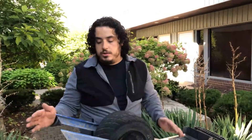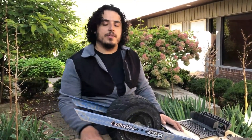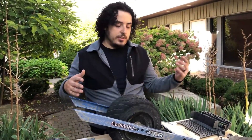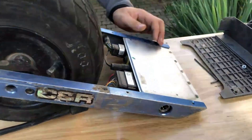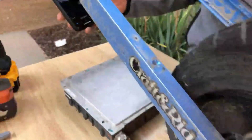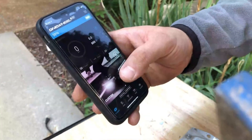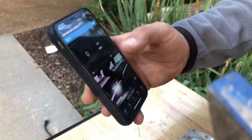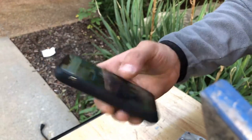Once you've secured the battery and it's all sealed up, a good step is to actually plug it in and make sure everything is working — that the harness isn't damaged and the battery is plugged in correctly — before reassembling, just in case you have to take it all back apart. Plug in the connector, power the board on, and your light should turn on and remain on as normal. Connect to it with the Onewheel app and try changing a mode. We're activated and at a full 98%. No errors come up, so we are perfectly good. Now power the board off and unplug the connector.